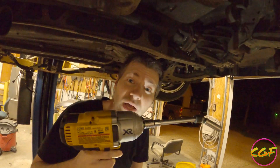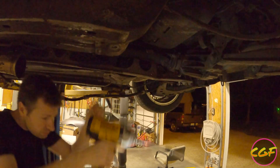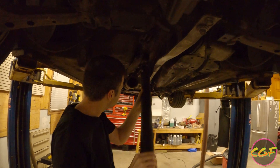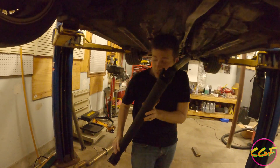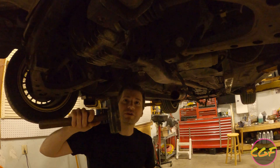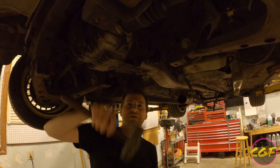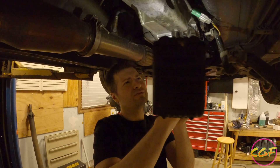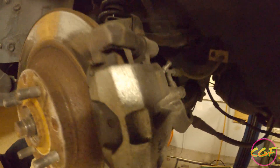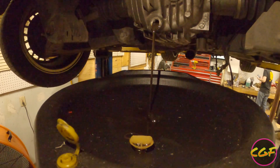If you don't have power tools — get power tools. Do you see how easy this is? The driveshaft is about to come out. It just kind of slips off — it's called a slip yoke; it slips. Then you get your favorite hammer. I took the wheel off, took the axle nut off with the big impact, and now I'm taking the top off. Then we're going to pry the axle out. But first, before you make a mess, drain the fluid — good old stinky gear oil.